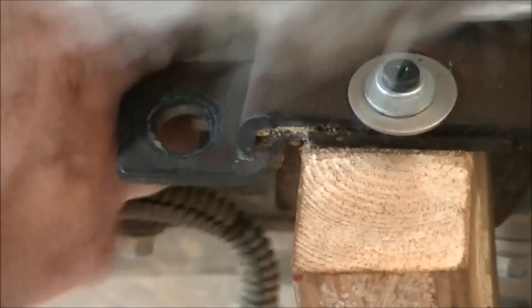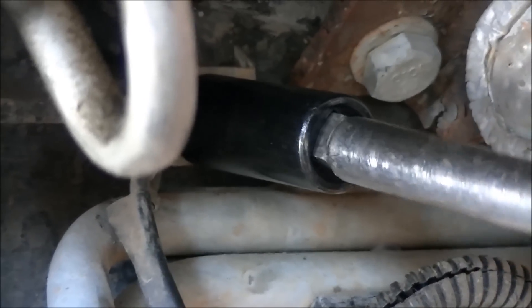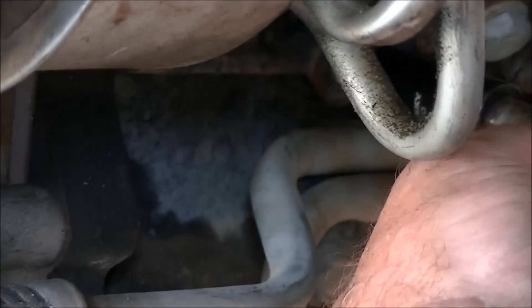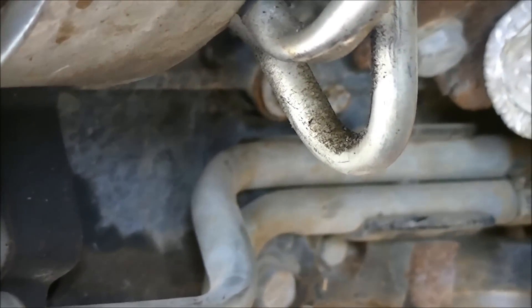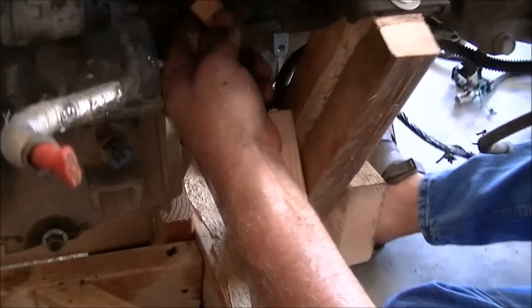I'm going to have to cut that. The way they do this, you can't undo the nut to get the ground off until you cut it, because it's all pushed together as one assembly. They make everything to be pushed together — nothing to come apart. Let me put that back so I remember that's the ground. I'm going to put a little piece of blue tape on that. Another knock sensor or something on this side — exactly the same, screwed into the block. I need to look up the schematic to figure out what it is.